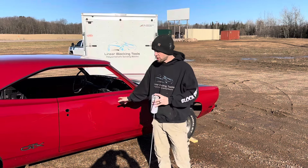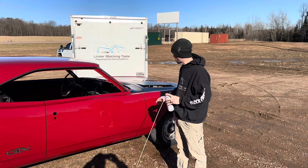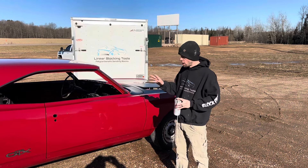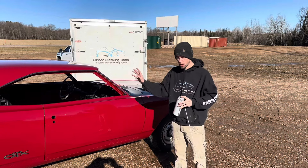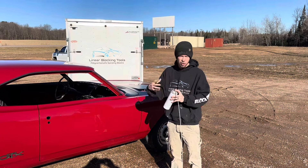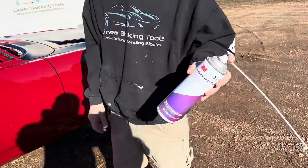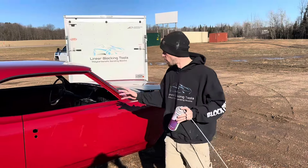Today we've got the GTX basically done — wiped down and ready to load in the trailer. The last step on these cars, especially one that's been cut apart and welded on, is that there's metal that may be unprotected in certain cavities. This is where the 3M cavity wax plus comes in — we're going to cavity fog this car.